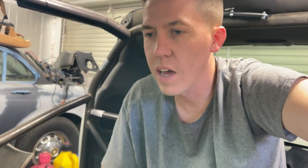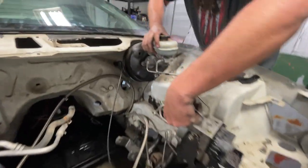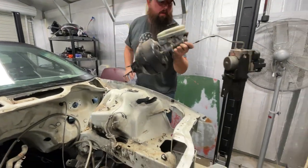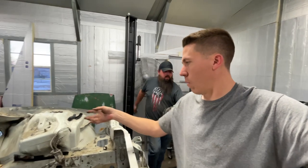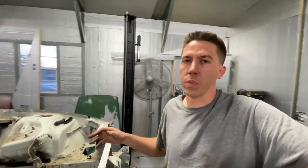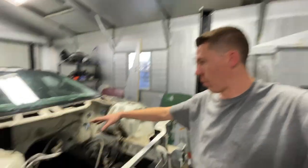So all right, we're gonna try to get the brake booster out of here and the big heavy ABS and brake booster maybe. Yes, there's a few pounds there too. Yeah, we're dropping all the weight on this unit. So everything's gonna go back like a manual brake master cylinder, and then no ABS, but it'll have a little proportioning valve, but everything's gonna get so much lighter with this build. Just simplified, easier to work around, and it'll clear up a bunch of room.